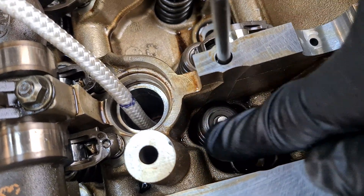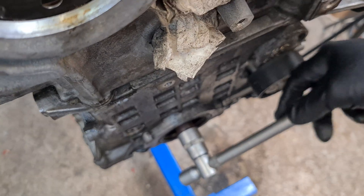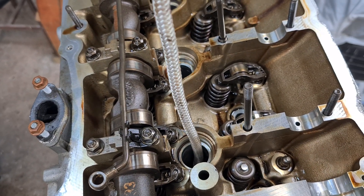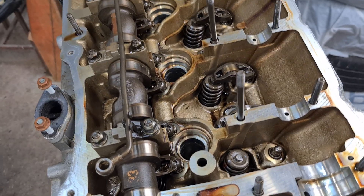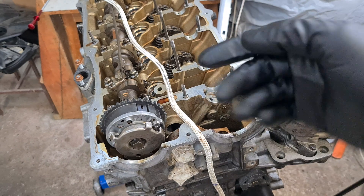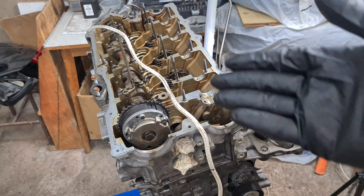Here it is, it's back together — that was pretty easy. When we've done all four valves we can undo the tension by rotating counterclockwise this time. You don't have to go all the way, just release the tension and now you can start pulling out the rope. And it's out. This is the rope method — I hope you've enjoyed this video and learned something useful. If you have any questions put them in the comment section and I'll try to answer. Thanks for watching, consider subscribing for more videos, and keep zen and continue the art of BMW maintenance.